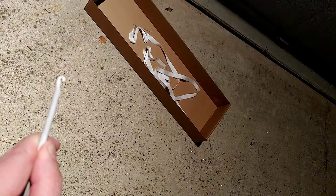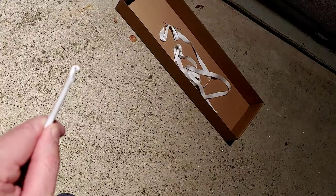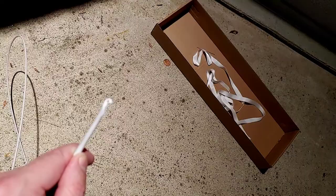I'm going to use a box cutter to do that. You see how the end looks now? Skinned it down, but I rolled it over so it's not going to tear on anything. And that'll go through those gaps better. So you might want to use that technique on the other ones too, but in this case, I am going to use it on this one. I didn't do it on the other two, but that gap's a lot tighter. Feeding it into this groove here, and this is how this works right here. This plastic paddle is pushing it into the groove, and then you push a little along, you do a little more.